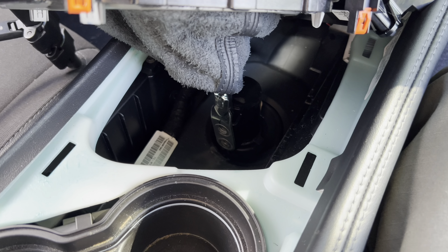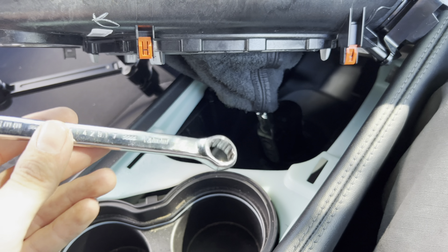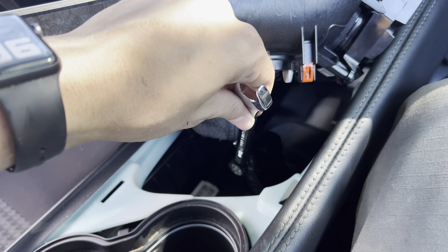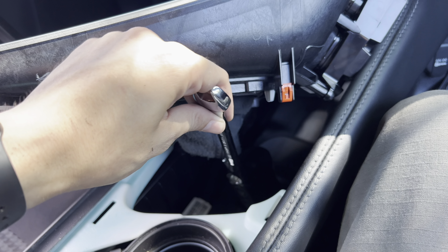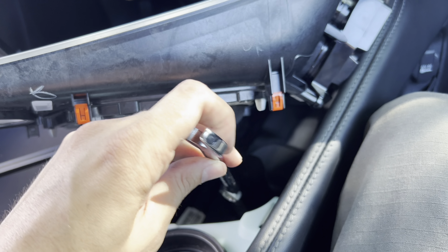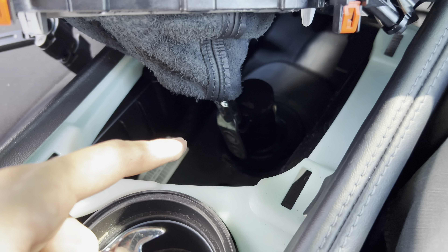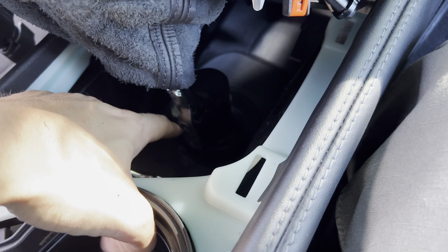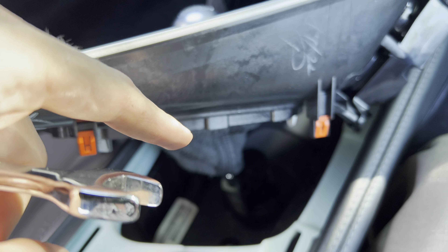They'll never have a recall on loose shifters, because that was hard to get out. I took the box end of our combination wrench and put it down on here. Depending on where the bolts landed from the factory, you just find where you can get your wrench in. I put the shifter in first gear — that seemed to give me the best leverage and room to turn it left. It took a few bites to get it, but once it loosened up they came right out. I did the top one first because it's easiest to get to, and that left a flush surface so you could get your wrench right to the next hole. Now we're ready to slide this thing out and address getting the new shifter through the boot.